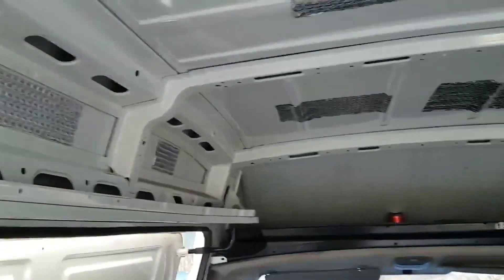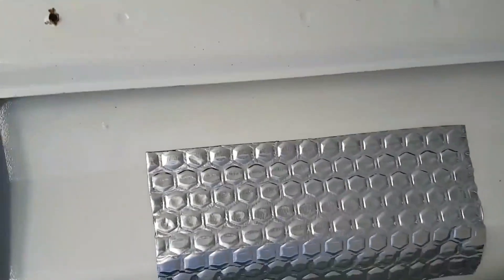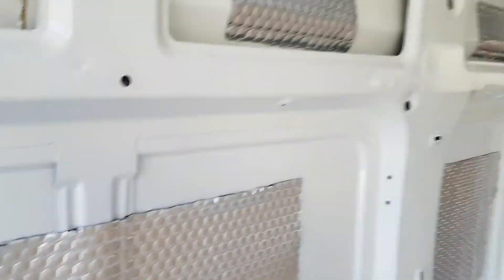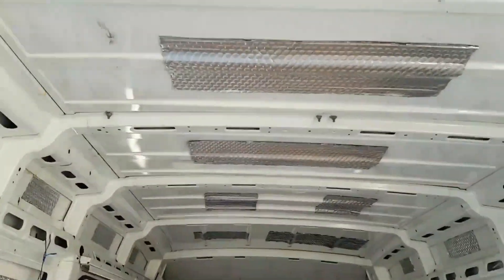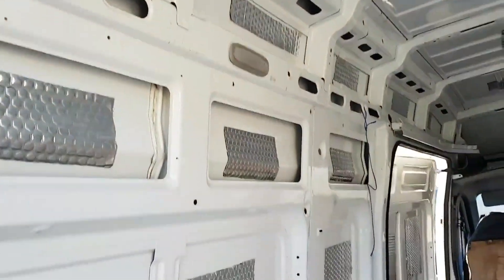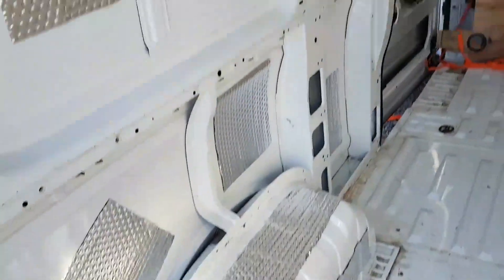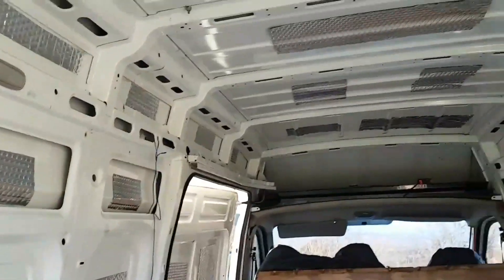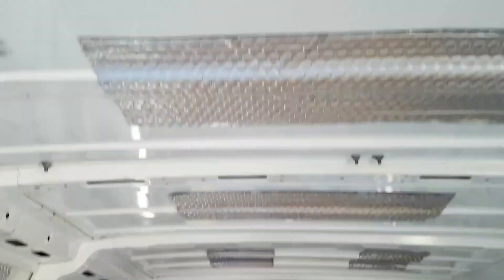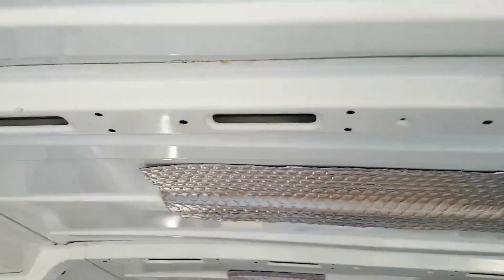Just with these little bits on it, it kills the rattles straight away. That's 50-60 quid well, well spent, I'm telling you. Before the wiring and the insulation goes in and things like that, yeah, well worth doing. I'm just going to hit it with a roller now, just flatten it all out a wee bit — take away the bubbles — but you don't want to overkill with it really. I probably have done a little bit too much on some of the panels, but just enough I think, even on the roof.